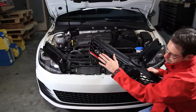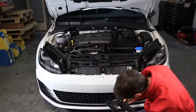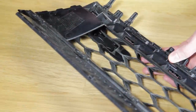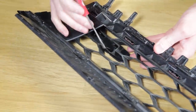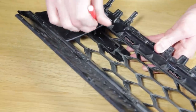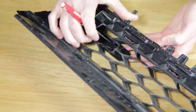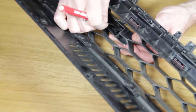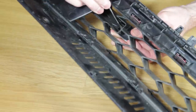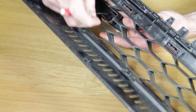Now we're going to swap over the GTI logo because we have the GTD grill, so all we're going to do is flip it over and release the tabs that hold it on the back. Here on the back side of the GTI grill, there are four tabs total and it's a tension fit — you push forward while going from underneath the grill and pull down on the front of the emblem. As you push the tabs in it will release forward and you can pop your emblem out.